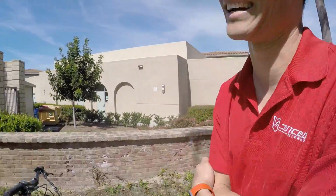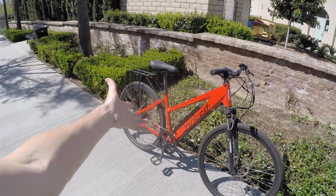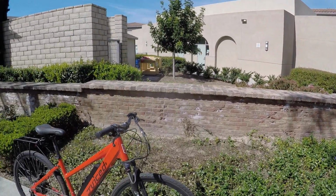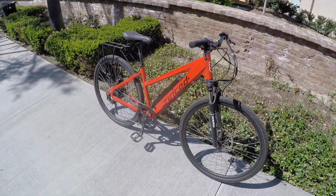They help us a lot, and we do some tricky stuff with this one that I think a lot of people don't do. We run them at a fairly quick speed. You do. And 350 watt nominal up to 650. Yeah, but we overboost it with the torque sensor. We really push it a little bit, and we only do it for a few seconds. There's a lot of software stuff that we do. So when you ride this bike, it goes really fast, but it's doing that in a way not to destroy the bike.